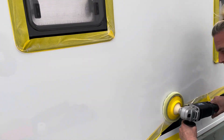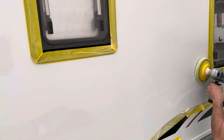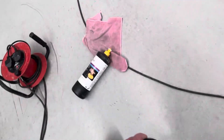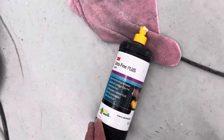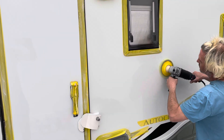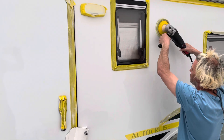The most important thing is work in small areas — go over it with a green top compound like this, then go over it with a finer compound. You could go over with a blue top compound but I haven't bothered, I've just waxed it, and literally you're going to get the shine come back into this fiberglass.